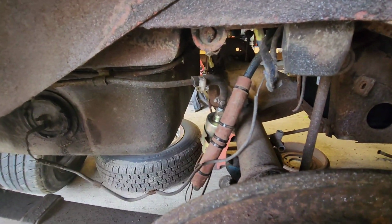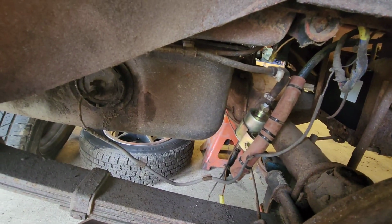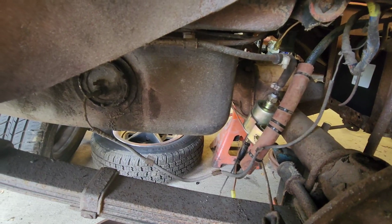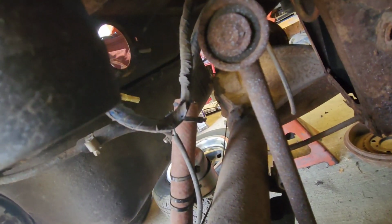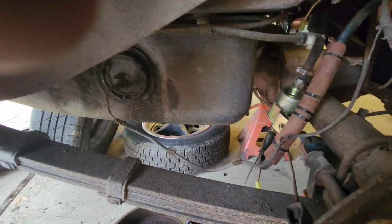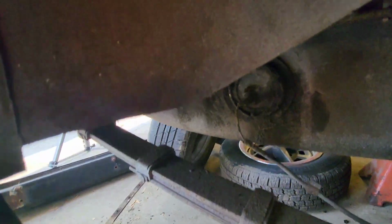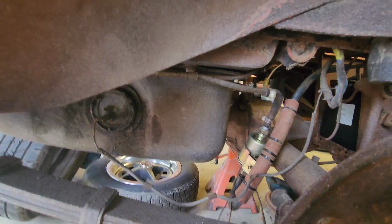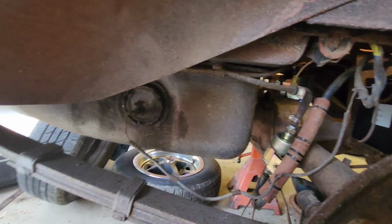First we're just going to plumb it in here and see what happens when we turn it on before we mount it and everything, because part of my fear is also that being up there, it will be mounted too high and it will actually not draw fuel either, because that will have it pretty significant ways above the fuel tank, which these things don't really like. So now to figure that out.